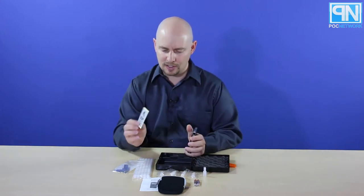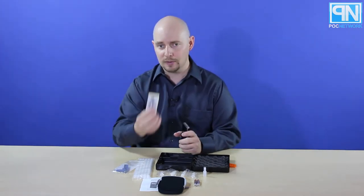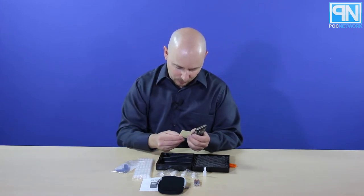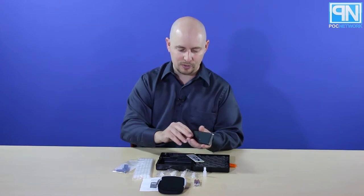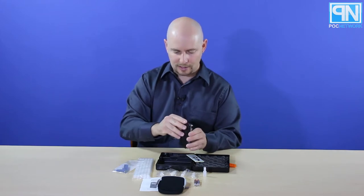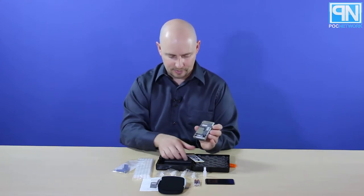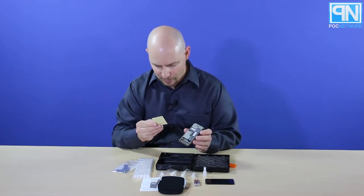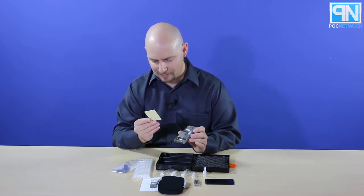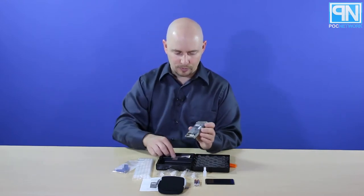There are instructions — besides the main booklet, there's a small separate sheet you can stick on the back or inside the case. It details how to get the cartridge in: you remove the battery cover by pushing up on the groove at the bottom, which pops everything out. Then you grab the handles and pull down on the side indicated on the sensor module case to remove it, and reverse the steps to put it back.